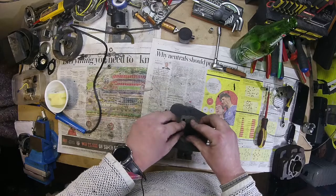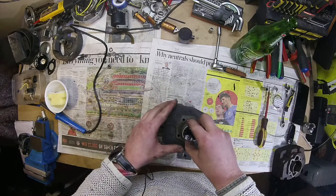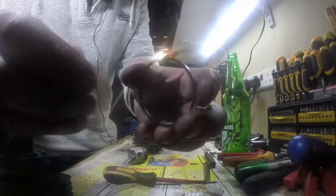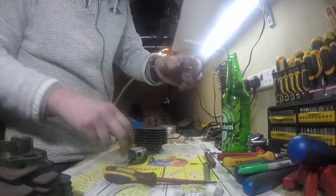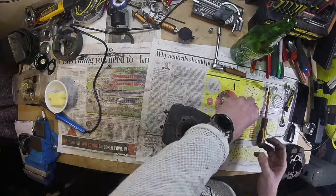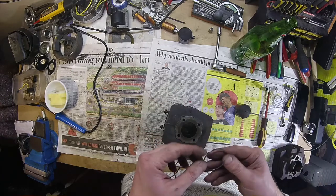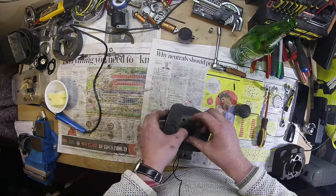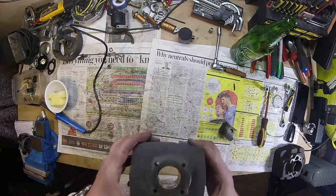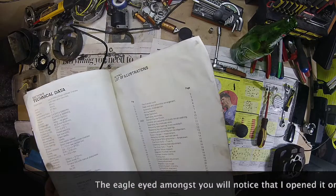Right — rings. This is the cylinder we know is good. What you do is you put your rings in like so, make sure they're all squared up. Put them in with the piston — and these have got a C-clip on them, so this type of ring has got a C cut-out there. A little C cut-out, and that matches up as you go up around to the little locating pin — all that does is stop these rings from turning around. Because you've got ports in here, the last thing you want is for that gap to pass over a port, open up inside the port, and then smash itself to bits. So we're just going to put this in here. Bloody hell, that looks really good — so maybe that's why it's getting blow-by, maybe it's just one of those things.